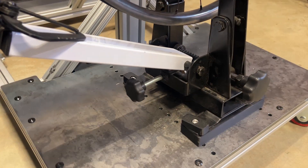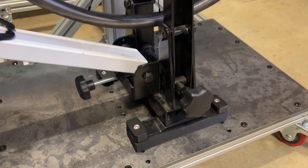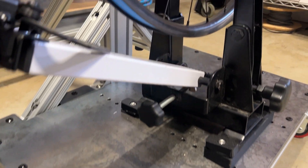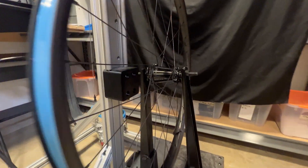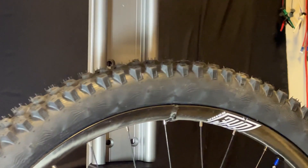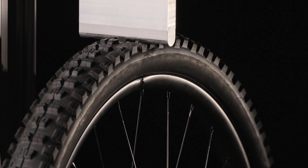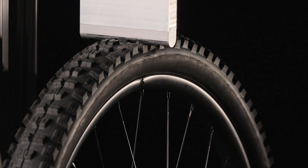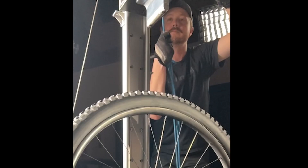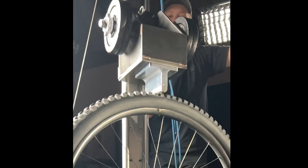We used an off-the-shelf wheel stand — it's pretty hefty, made out of steel. In a perfect world we'd use a really hefty custom-made wheel stand, but it's not quite in the budget yet. This works really well. We were able to angle the wheel stand with these solid 3D-printed spacers so that we can change the angle of attack for the impact anvil. You can see the impact anvil is coming in at about a five-degree angle, or rather we've tilted the wheel five degrees. This is pretty normal. The failure mode for most modern rims is from a single-sided impact — if you hit both rim flanges straight on at the same time, the rim takes a lot of energy to break with or without an insert, and that's not the reason why your rims fail in the field. Usually it is a single-sided impact similar to what we're seeing here. That's why we built that adjustment into the impactor, so that we could study that scenario specifically.